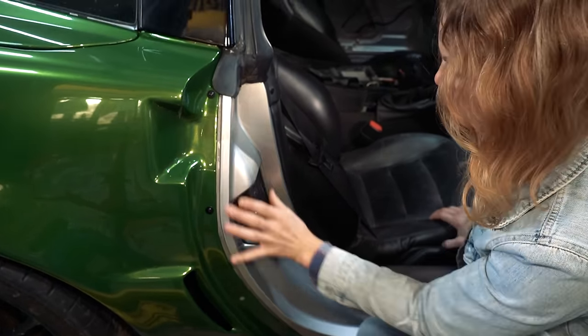On the steering wheel, what I did was I took some bolts and I ground them down. I made them oblong. That was a normal bolt. I just ground two sides off of it and then shaped it until it would go in there. That's an oval hole. So once you put it down in there, you twist it and it locks in. And then I use just a normal puller, just like that. Worked pretty good though. So if you don't have the right tools, that'll work.